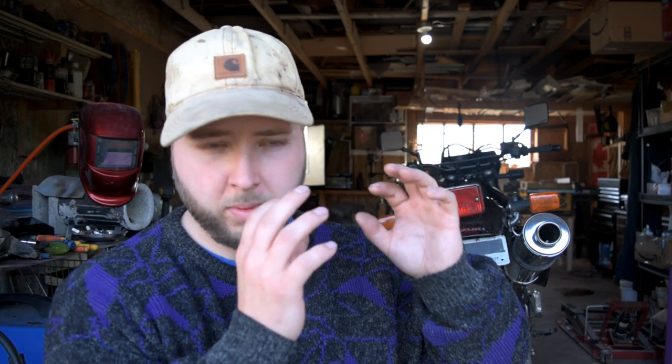We want to open up the air box - it's really the only way to get mass air flow into this bike. We'll actually be cutting the air box, and I have some jets here we're going to play with. The reason that this is the most daunting part is that carb work like this can be really trial and error based. There's no exact set of steps that guarantees your bike will run flawlessly. There's some tuning and tinkering - the needle position might not be right, the jet might not be right.